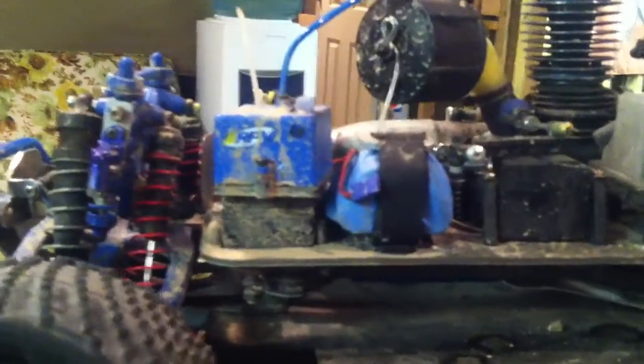front brakes. But boy, if you look at how my driveline angles and everything worked out, it's probably not very good light, but the rear driveline worked out to where I could keep it basically stock. I mean, they're the CVDs that I have, part of that Dynamite kit. The front I did have to cut and weld because it had to be lengthened a little bit. So that was a little bit of a custom application, but other than that, it was a real straightforward assembly.